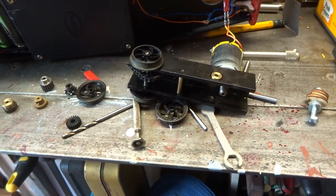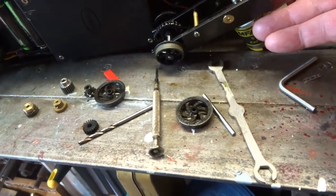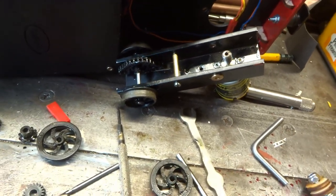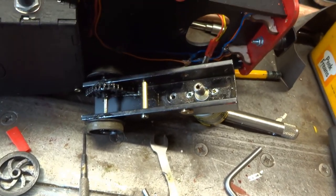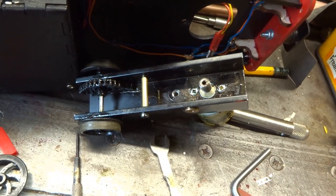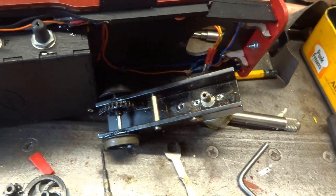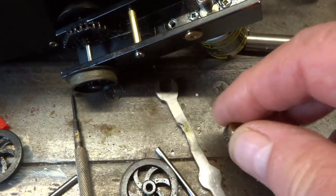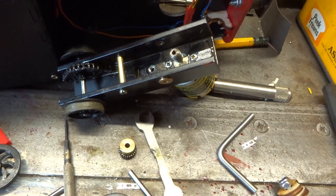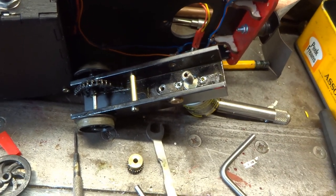I'm rethinking this motor drive unit for this Tenden rail car a little bit. I'm thinking, whilst dissimilar metals in engineering applications are often quite a good idea, I suppose the classic is the crankshaft of a motor car, hardened steel of various sorts, and you know, the soft white metal bearings of the conrods. I'm thinking that this steel worm driving what is effectively a soft brass pinion ain't a great idea. And what's happened, of course, is the pinion is now destroyed because in many ways this worm is acting like a milling cutter in my view.